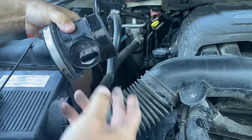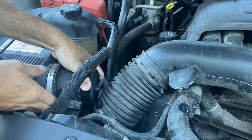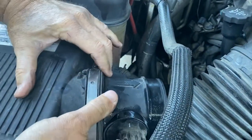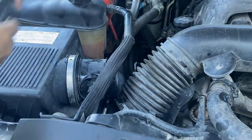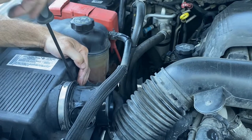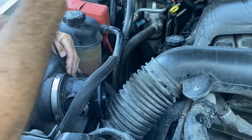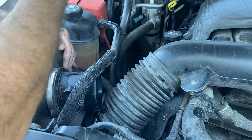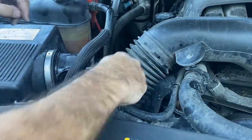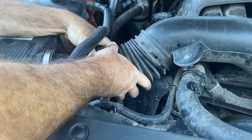You see it's got an arrow and we know that the wire is on this side, so it goes just like that. I'm going to start this side first. There's a little tab right here — it's got to go right in between that tab, just like that. I can tighten this side down. I've got a lot of cars that are running poorly that all they needed was the mass airflow sensor cleaned. That one's tight. Now I'm going to do this other side — put the oil on it and it just slides on nice and easy just like that. Tighten that one up.